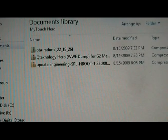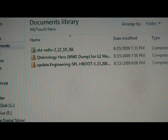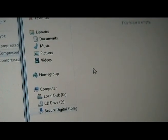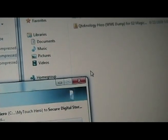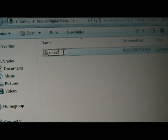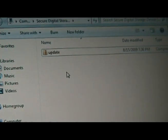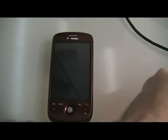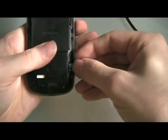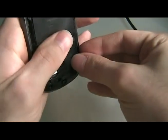I've downloaded a Hero 32B Magic ROM, since most people here are going to want to load Hero. Once it's done downloading, take that and put it on the memory card. Once the ROM you want is on the memory card, rename it to 'update.' Once that's done, close the SD card and take it out from the computer.